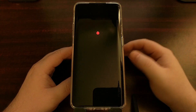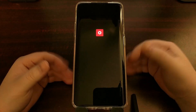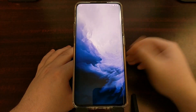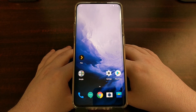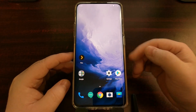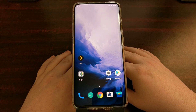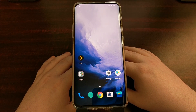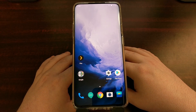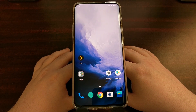It's possible, although very unlikely, that you accidentally boot into fastboot mode. If that happens, just make sure the Start option is highlighted, press the power button, and you should boot back into Android — unless you have a corrupted Android install and are boot-looping into fastboot mode, in which case you'll need to follow an unbrick tutorial. There are also other reasons to boot into fastboot mode on the OnePlus 7 and 7 Pro, which I'll cover in future tutorials.